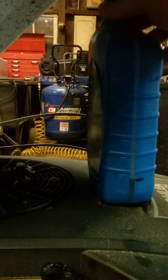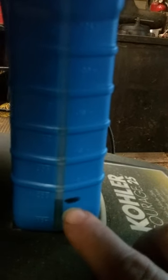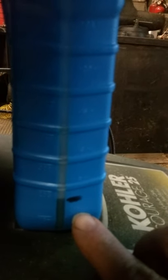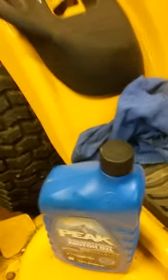On the other side, we're going to talk about the six ounces of oil we said we'd leave out. Right here at my fingernail that's eight ounces, down here is four ounces, and right in between is six. So we're going to put all but six ounces in this lawnmower, then pour in the other quart, and then we're going to check the oil and see if it's on the dipstick at the full mark right here.